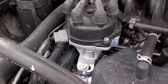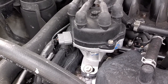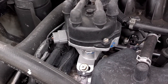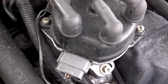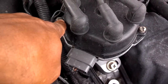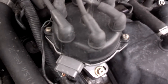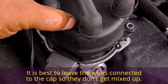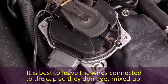So what I'm going to do is take it out of the vehicle and see if there's any binding on the distributor. First thing you want to do is get a large flat-tip screwdriver. Take these two screws off to take the distributor cap off, then carefully work it off and set it to the side.